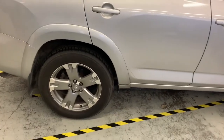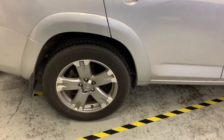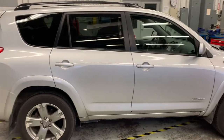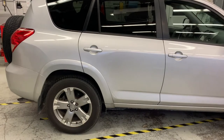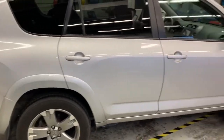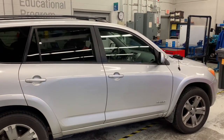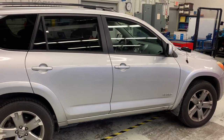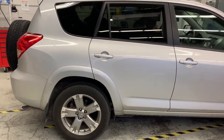It can sometimes be difficult to determine what's causing a brake pulsation. With this vehicle, a 2007 RAV4, while driving down the road, as soon as you hit the brakes after about five minutes of driving, you start feeling a brake pulsation — basically the vehicle shaking or shuddering under brakes. A lot of times that's just a warped brake rotor, but this vehicle feels fine when cold, and as soon as it starts to get warm there's a shudder, and the longer you drive it, the worse it gets. So I have a feeling that one of the brake calipers is seizing or stuck.